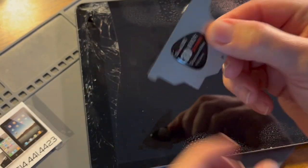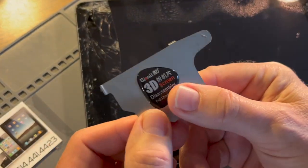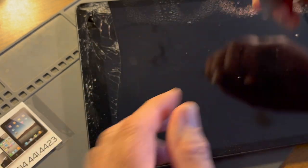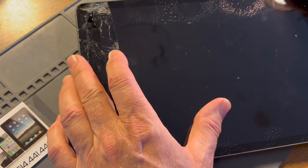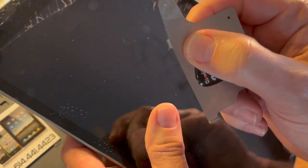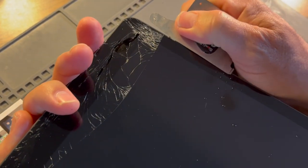That's where I come to this tool. You can find these on eBay or pretty much any supplier — I think I got this from Gadget Fix or maybe Mobile Centrics. And again, this area right here where I know that cable comes, I'm not going anywhere near it with this tool. This tool has this little tiny L-shaped end that's very, very small. You can fit it right down in and it will actually run along that seam there really easily. I'm even going to go up here where it is fragmented with this. Up here at the top there's quite a bit more adhesive than on these edges.